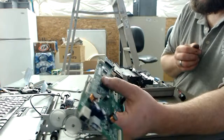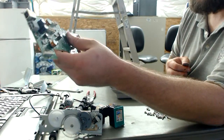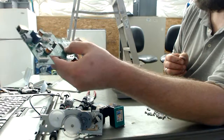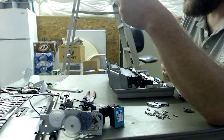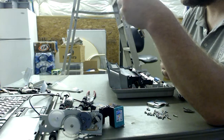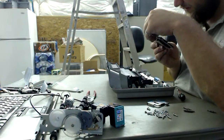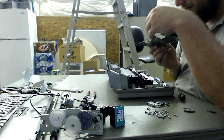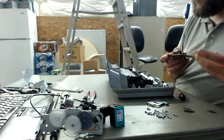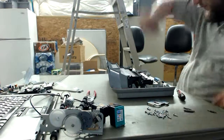And I'm guessing on this, the CPU is, well, they covered it up so you can't easily see what it is. My guess is it's probably another ARM CPU. Those things are just awesome and easy and ubiquitous. Memory chip as well by Hynix. Bet you if you actually use a memory reader, you could probably read what's off of that, or it may be RAM. Not sure. There's another chip over here. Lots of little parts on here you can play around with. And of course, look the part numbers up on Google, wherever, part searches, and you can then unsolder them and use them in your own projects as you see fit.